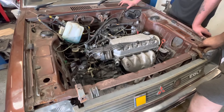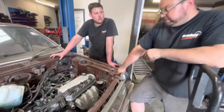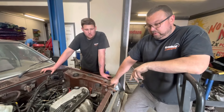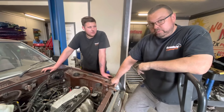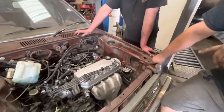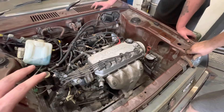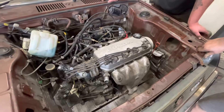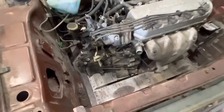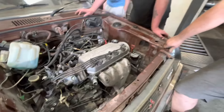The engine will be in on its own. I think what we're going to do for the dog bone mount is where the aircon pump originally bolts on the front. Because the front cradle goes on this car for the tie rods going back to the lower arms, that actually added the original engine mount on that. And we're going to use that and tie it to make a dog bone mount up. So that would be quite nice. You've got to come back out again now. Obviously we're still in mock up stages. I didn't put the whole part big enough over there, so that's got to be done. There's a few bits that have got to be sorted, but potentially we've now made a good start and we've got one side in.